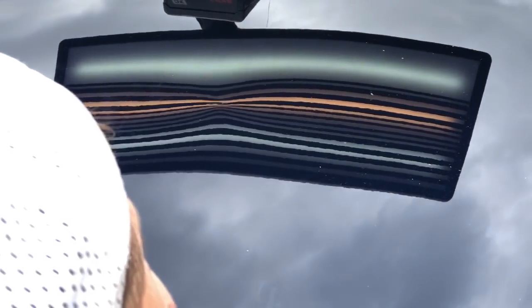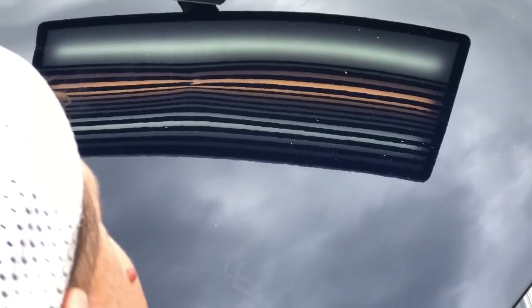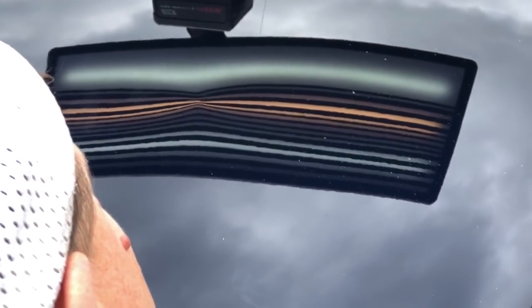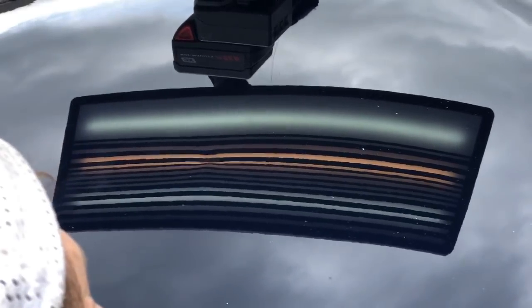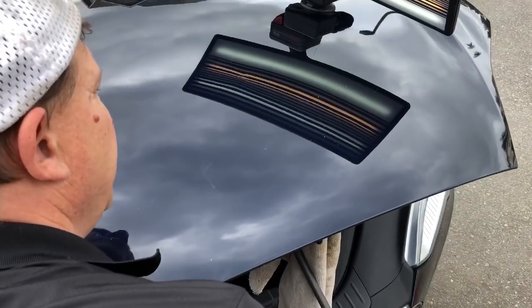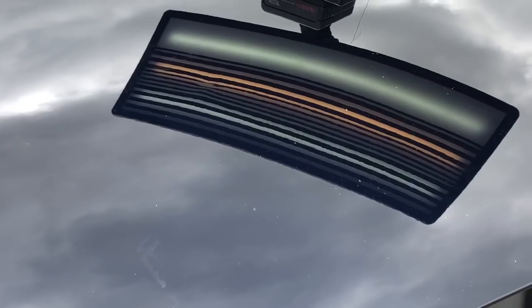If anybody wants to know why am I not getting it super hot, because it's already about 80 degrees, the metal, 70 to 80 degrees right now with the sun on it, and it's aluminum. The aluminum makes the metal move really funky, and it heats up quicker than the paint. So for me, it's a little bit easier just to work on the straight aluminum in a nice 74 degree day, 80 degree panel, and just take the dent out as I'm doing here.